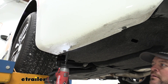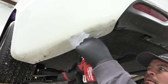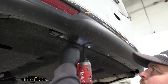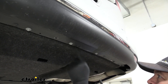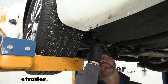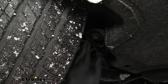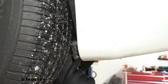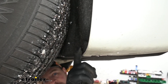Along our driver side quarter panel here, we'll start removing our 8 millimeter bolts. On the driver side, behind your tire where your panel hits your fender liner, there are going to be two 8 millimeter bolts inside we need to remove. There's another one right behind the tire. This panel wraps down and underneath, so we need to take off this inside one.